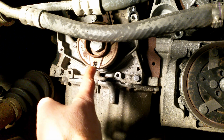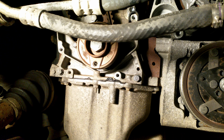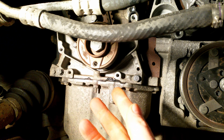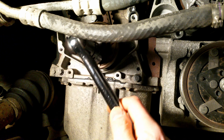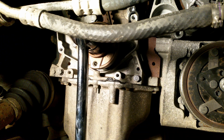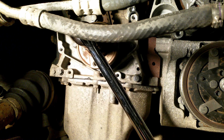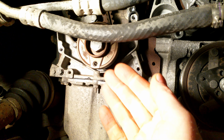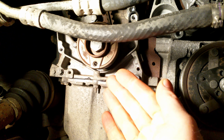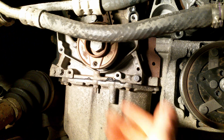At the crankshaft, the cut here is pointing straight down. I've pinned the crankshaft on the flywheel and removed the two pins from the two sprockets. This is 22 millimeters. I'll try to really push the engine but there is nothing moving. So now I know that the crankshaft has been pinned at the flywheel, and when I remove the belt this won't slip and lose timing.